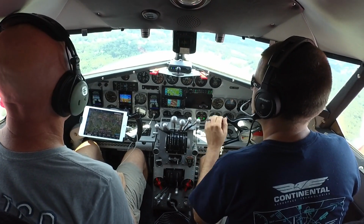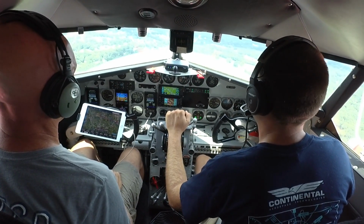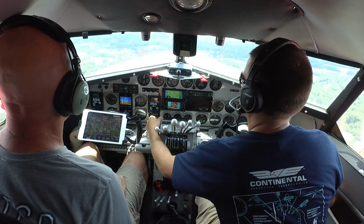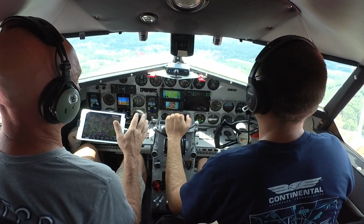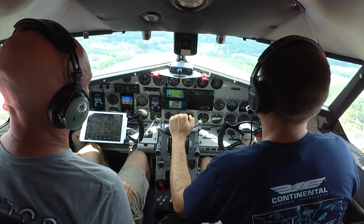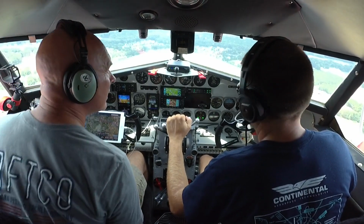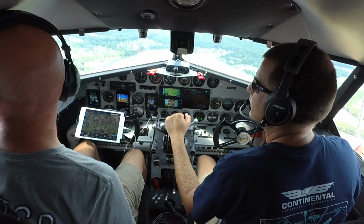Alright, there's flaps 2. Alright, so we're looking for 90. We got the flaps. Just going to hold what you got. So right now you're climbing, so we can pull back on the manifold to about 23, maybe 22. We're clear on the right. You got the radios.